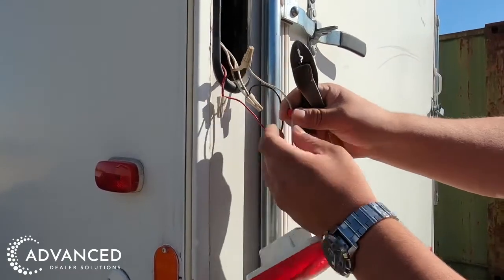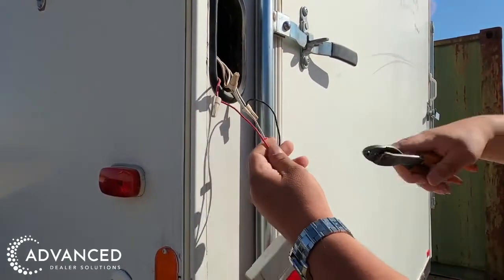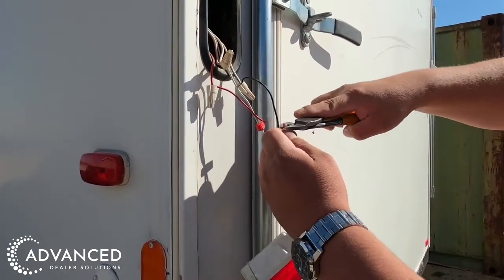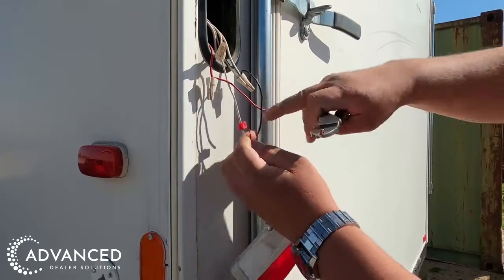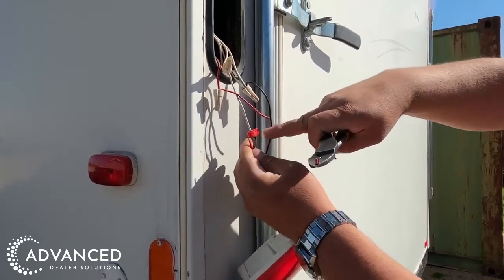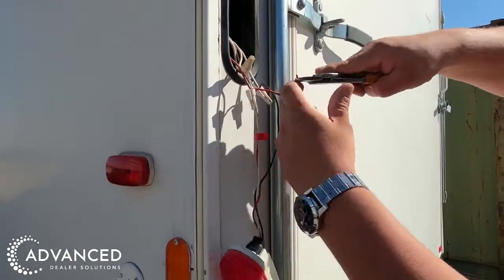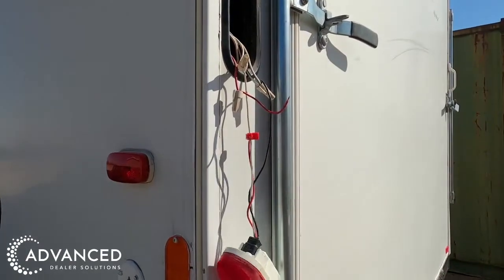With the slack pulled out, clip the positive wire. Be sure to clip it the same distance from the bulb as you attach the T-tap to the ground wire. This keeps the module from being installed lopsided. Strip both ends of the positive wire about 1/4 inch from the tips.